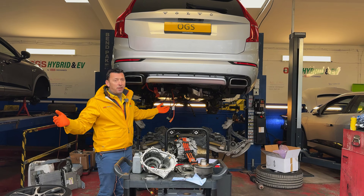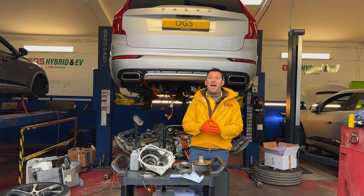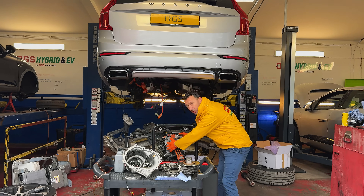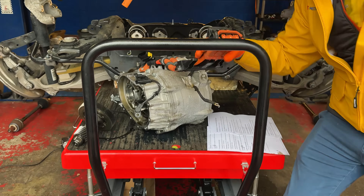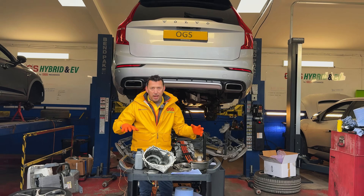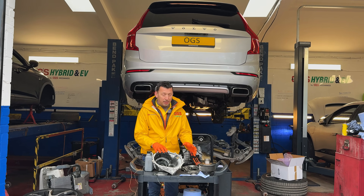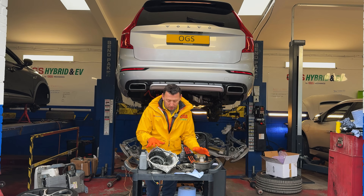So what is the electric drive? ERAD stands for electric rear axle drive. Basically it's an electric motor — the component here — a three-phase electric motor, obviously controlled through an inverter and a control unit, and then there's the mechanical side of it, which is the diff. The problem most of the time lies within the differential, and at some point the motor can be affected. But everything starts from those components.